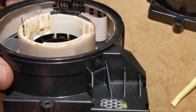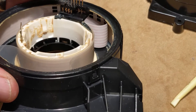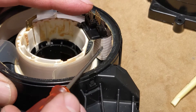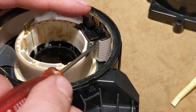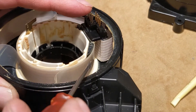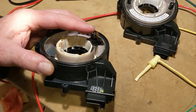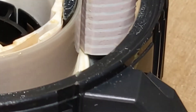Testing the clock spring, we found it to be intermittent with a bad connection on one pin. I can see right here there's a hard crease in this flexible PCB board, and that's probably where the conductive traces are broken. It's right underneath this connector, so it's a little hard to see, but you can see it as it rotates by — there's a hard crease where there shouldn't be.